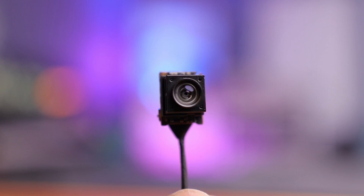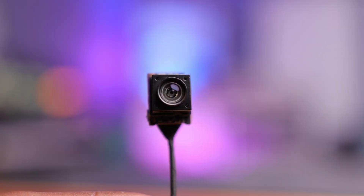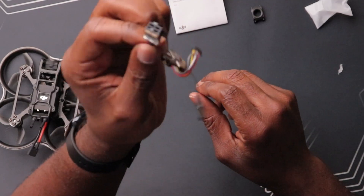This is a 4K camera capable of around 60 frames per second, and you can get higher frame rates by lowering resolution - around 120 frames per second at 1080p. This features a half-inch sensor, which is pretty impressive for a drone of this size, similar to the camera on the DJI Avata drone. That has pretty adequate image quality - not the best, but for the application it's made for, these smaller drones, it's more than enough. This has a field of view around 117 degrees, which is not the widest. The O3 Air unit has 155 degrees field of view, and I wish this one had that.